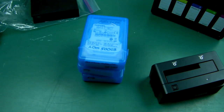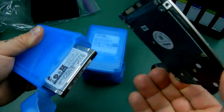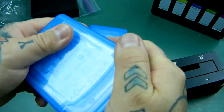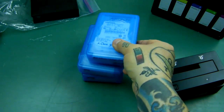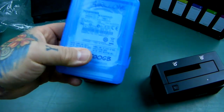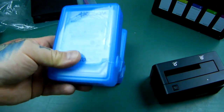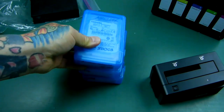Something else really important to do — especially if you're traveling — is carry a hard drive clone. I've got my MacBook Air clone on this one little hard drive, which is only 500 gigabytes. You clone your MacBook Pro, your Mac Mini, even if you've got a Windows machine. Carry around a hard drive clone. Download the free software application called SuperDuper and clone your hard drive. So if your hard drive ever crashes, and you need to go buy yourself a new MacBook Pro or MacBook Air — it doesn't matter if it's got a solid state drive in it. If my computer dies and I'm in Europe, I've got this hard drive with me — I've got all my apps, everything, an exact clone of my solid state drive. All I have to do is buy myself a new MacBook Air in Europe, reverse clone everything from here to there, and it is like my computer never died at all.